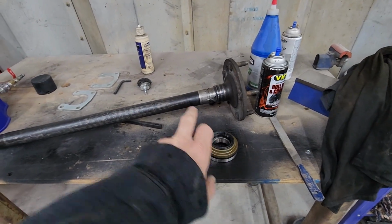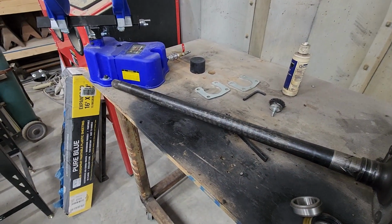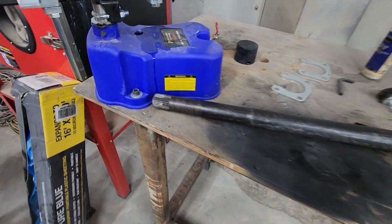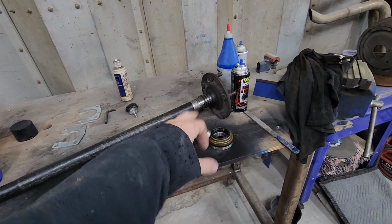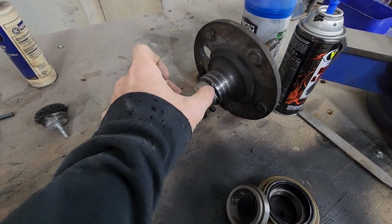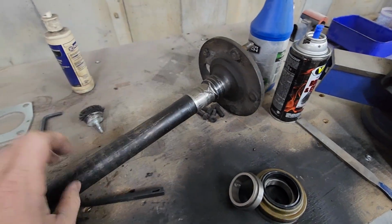And I goofed up hard on this axle shaft. I'm gonna install the bearings and run them, and I'm gonna be on the scoop for some chromoly shafts, because this one has been cut and ground a couple times, and when you use the grinder, sometimes you nick them. I'm gonna suggest that this is not gonna last long with hard wheeling, but we will find out, okay?